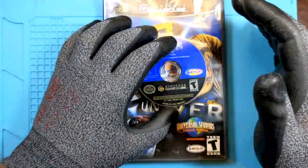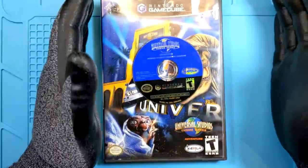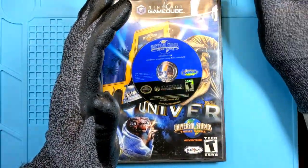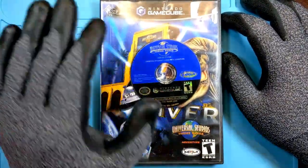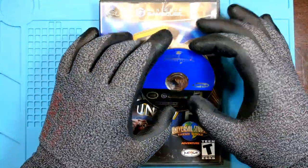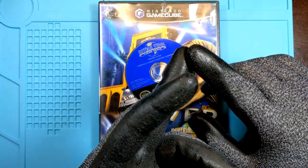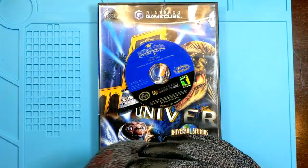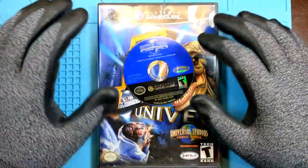It's always best to take steps: got a disc that doesn't work — wipe it off, remove fingerprints, spray a little water and wipe it off. Still doesn't work? Try some Novus. Still doesn't work? Then start getting into deeper techniques. Some of the discs I have look flawless, which tells me it's either a structural issue or the disc was heated at some point — heat affects the data layer in the middle, not necessarily the polycarbonate on the outside.